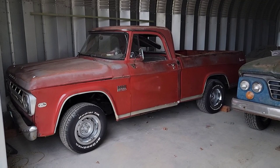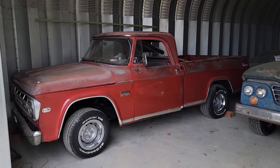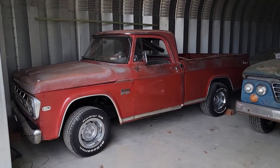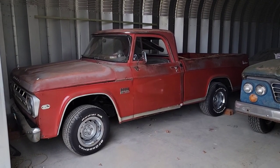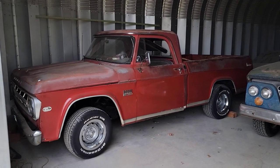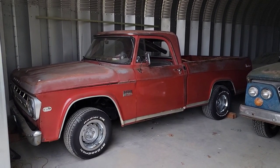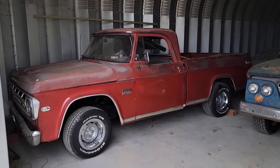Now that's not the same as the 383s in the cars of the same era. I believe it was 258 horsepower. They were two-barrels, but still — pretty cool, the factory big block short box, half-ton two-wheel-drive pickup. Kind of a factory muscle truck. The color is called Torador Red, not to be confused with Tor-Red for Plymouth, and it was a 727 automatic with an eight-and-three-quarter rear.